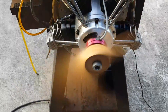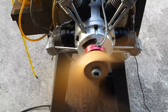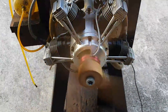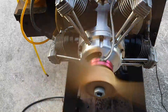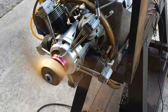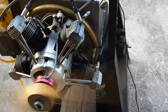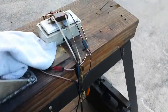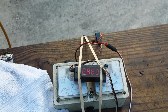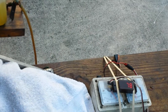Hello everyone, this is Adrian from CH. Today we have an OS 5-cylinder engine. The prop is a ZAR 2410. As you can see the setup right there — it has a collector ring. The engine is running right now on a 20 to 1 gasoline, idling around 760, 750 somewhere there. The engine is pretty good.